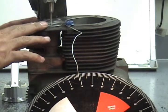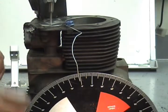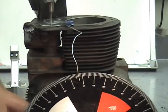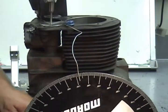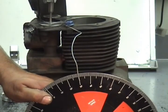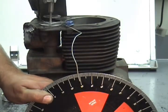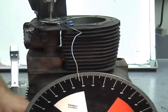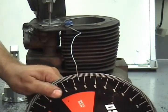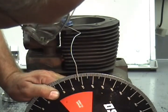Now we're going to check the duration of this camshaft — I believe this is a 282-degree camshaft. We're going to make sure this thing's on zero, then rotate to 50-thousandths opening and check that number. It should be coming up here as the intake valve starts to open. We're going to check it right about there — we're at 29 degrees. And we're going to roll around to 50-thousandths closing and see where we're at.